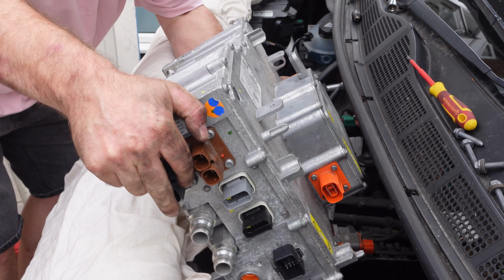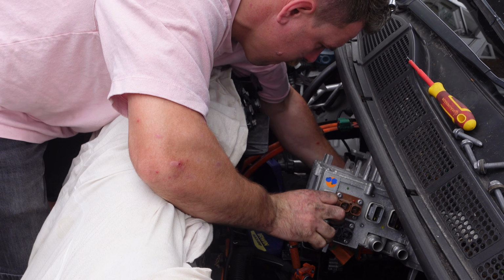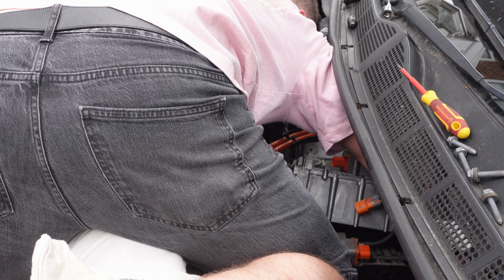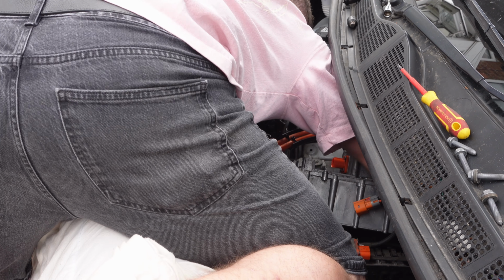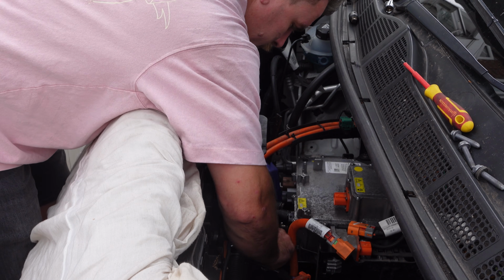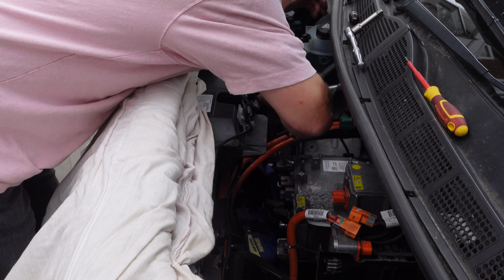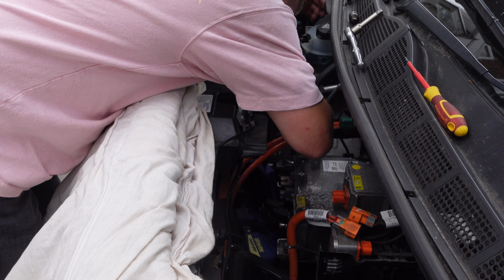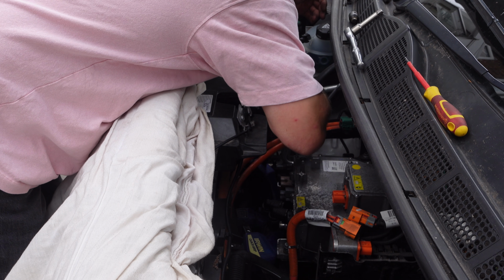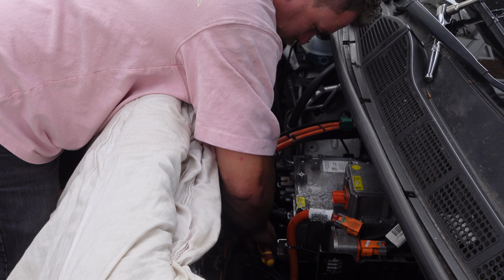With all of that sorted, the unit pops down and you're left just trying to connect the unit up to the underside. It's then time to practice your hand-eye coordination as you fumble around in the area where the two rear bolts hold the unit down. Do the same for the front two, thanking yourself that you left the easy ones to last. Maybe you should actually do the front ones first to make it easier to line the back ones up. I'd say that it's gone okay if I've only dropped one 10mm. One 10mm found. Okay, and then you're ready to pop your coolant hoses back on.